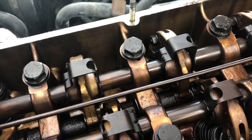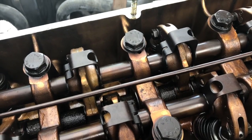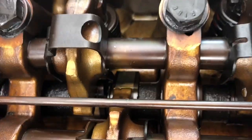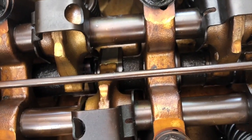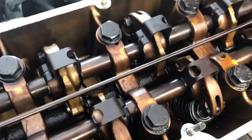This is a little more complicated and takes some experience, but with proper research and diagrams it'll be a lot easier. That lobe right there is facing up — you want the lobe facing down like it is here. The lobe looks kind of like a water drop extension, so the top of the water drop has to be facing down and the rounded lower part has to be facing up. That way you have the correct room to make the adjustment.